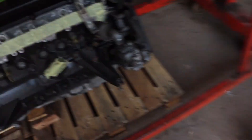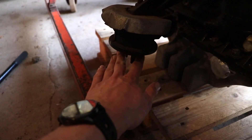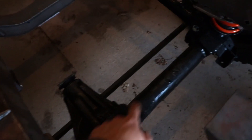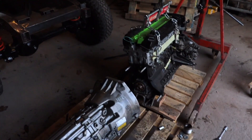As you can see here, the engine mounts do look quite promising. If it can stay within the frames on both sides, we just have to make a bit of an angle piece holding onto this bit and otherwise just make a plate that we can bolt onto the side of the chassis, both that way and that way. But of course fitment has to be controlled after we put in the bulkhead, the front of it, and then align the engine back and forth and up and down so we can clear the bonnet when it's closing, and the sump clears the axle at the rear. So quite a lot of factors go into placing this engine in there. But right now I'm going to take the studs out, open that box, have a look at what's inside, and hopefully mount everything on there. That should be the end goal of today.